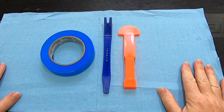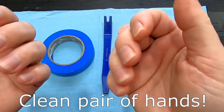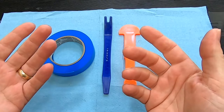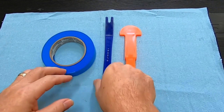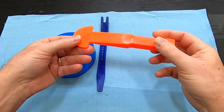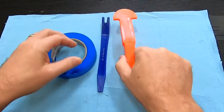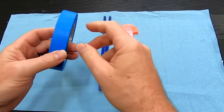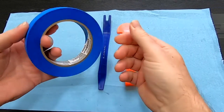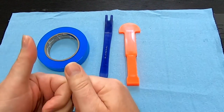The tools you need to remove the ski slope are really these ones. I'm going to try to do it without using any tools, so I'm just going to be using my clean hands. But depending on your car, you may need to use a trim tool — you might need a pry tool like this, pretty typical, or you might want to use one of these non-marring ones where you can slip this little thin end in. And if you're working near leather or any of the other finishes, you may want to lay down some blue tape to protect it. Probably don't need those — you just need these. Let's go give it a try.